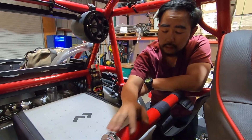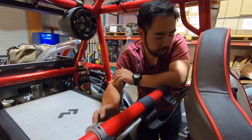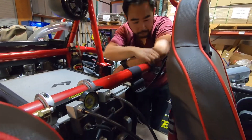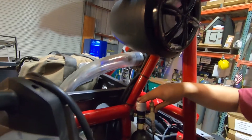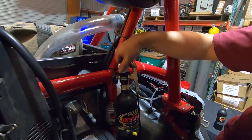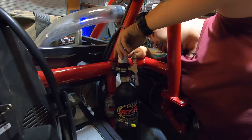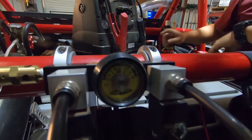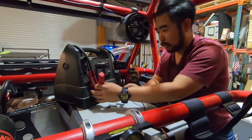This is a previous install that was already working with the compressor, so the electronics will need to be redone, but for now we can test it with a 12-volt supply plugged into the leads. Everything is pretty much hooked up. You can't see the gauges on the regulator but I'll show you how to set it. We have our main tank knob — we're going to open this up, give it a few turns. Then open our main regulator: ARB recommends 80 to 90 psi for their lockers, and that's about 90 — it'll reflect on the gauge.